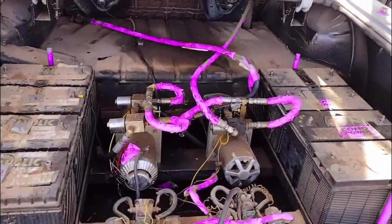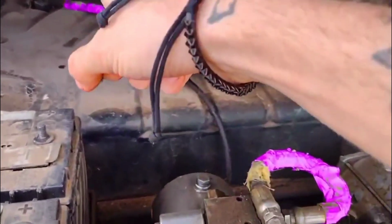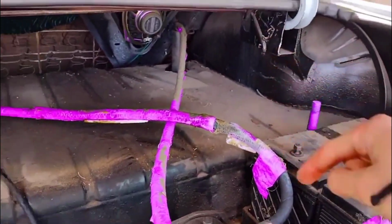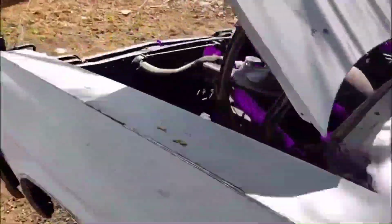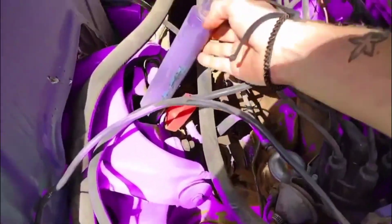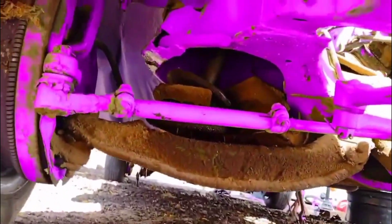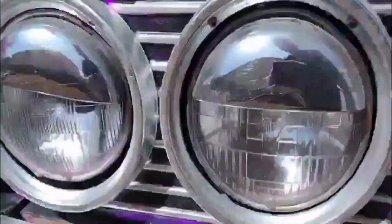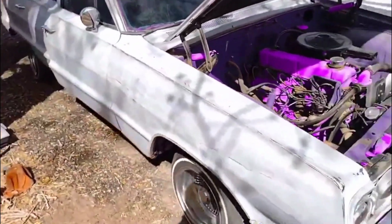Alright guys, so pretty much everything's leaking. The dumps are leaking. All the cylinders are leaking besides that one. They're not too bad to change. You can see them right here. So these are the cylinders. Pretty much all I have to do is unscrew that, take that out, and then underneath it'll slide out. And then it's just a little rubber ring right there. So then I could start hopping again and it won't sag.